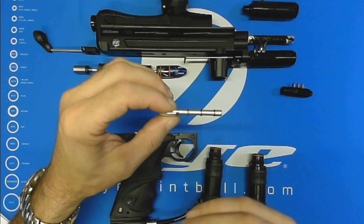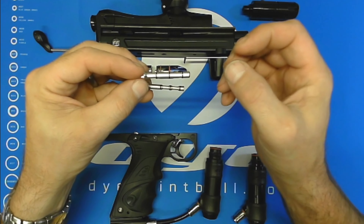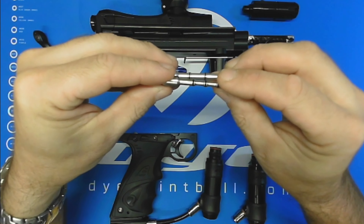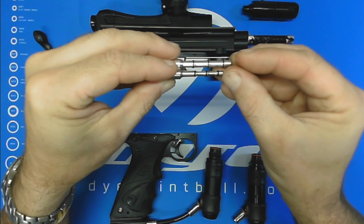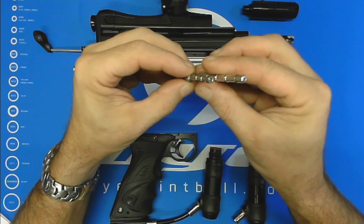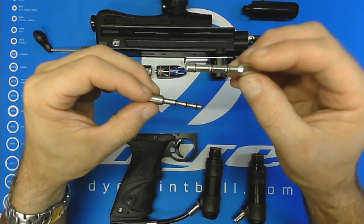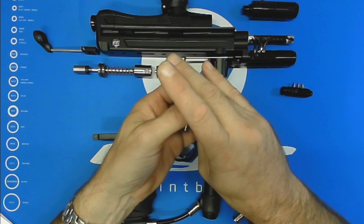For comparison, I've got another three-way shaft here from another company. You can see this company runs one millimeter wide o-rings where we're running 0.7 millimeter wide o-rings — that difference does matter. You can also see that we run a bigger shaft diameter overall, which allows us to have a thicker, stouter shaft while still maintaining really good flow, but with significantly less mass moving back and forth.